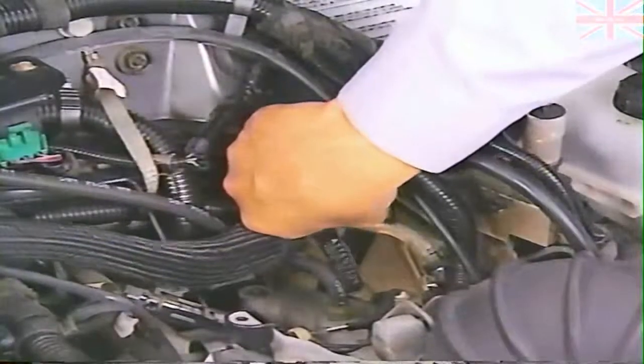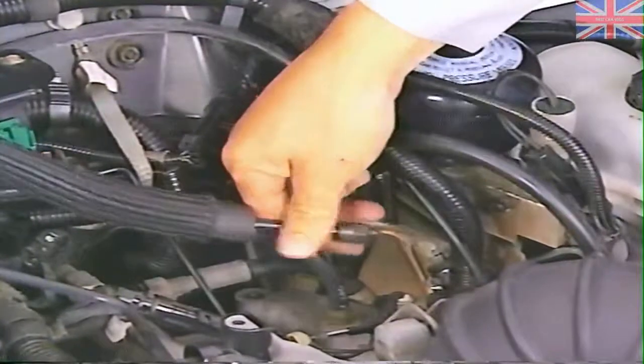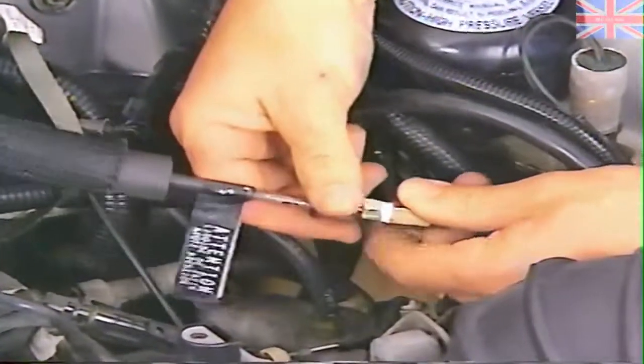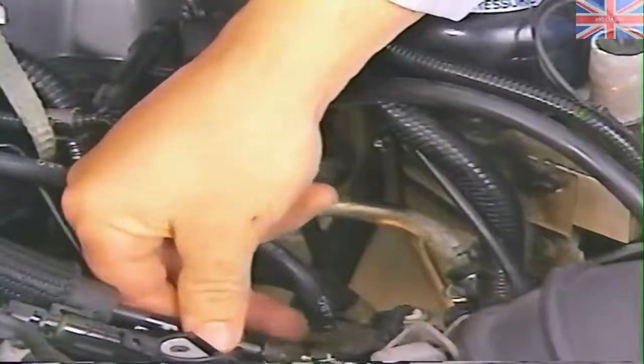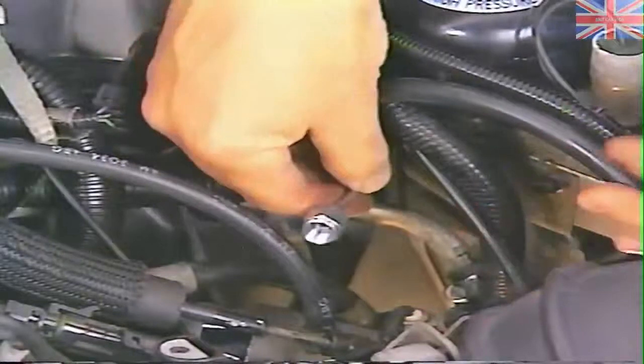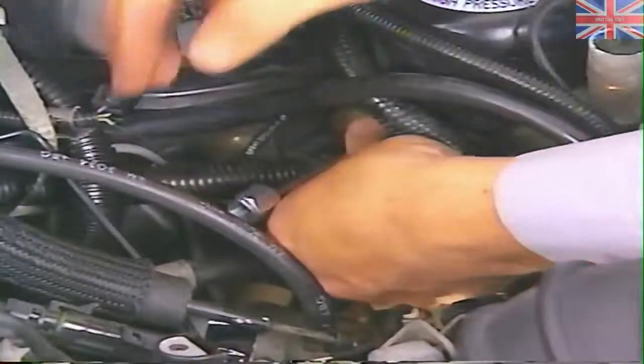In this situation, the pressure gauge with these adapters works similarly to the internal leakage test fixture. Before installing this special tool and the adapters, make sure the accumulator is completely depressurized. Then remove the pump motor outlet hose from the accumulator block inlet and install adapter 6868-2 to the pump motor outlet hose. Adapter 6868-1 is installed at the accumulator block inlet.